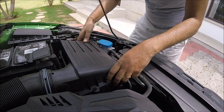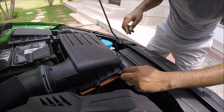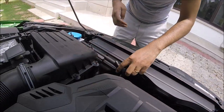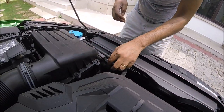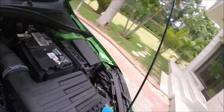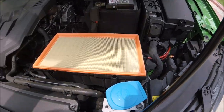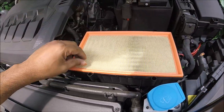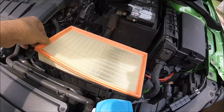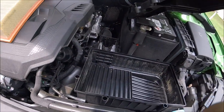Keep the screwdriver away, see if I can lift the cover. I think I have to remove this vacuum line — yeah, you can just pull it off and keep it to the side. It's an empty line, just make sure nothing goes into it. There is the intake cover removed. This is your air filter — you can just pull it off, it's plastic and paper. Air filter pulled off, just keep it in a clean place.